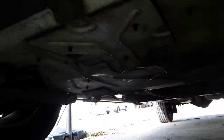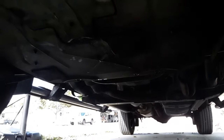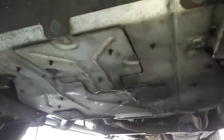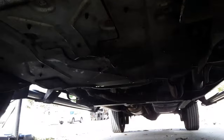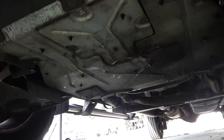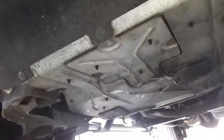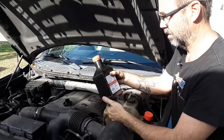So I didn't film it, but the bolts in the back are actually slide bolts — you can loosen them and slide the thing forward. Or you can do what I've been told some people do: drop those back bolts and drop the panel down, let it hang down and do things that way. So there are some options. We got it all buttoned back up and we're ready to add oil — Amsoil 100% synthetic 5W-30.